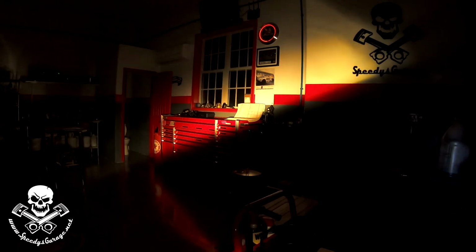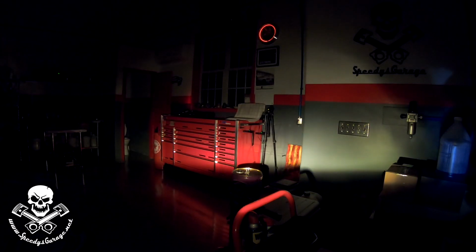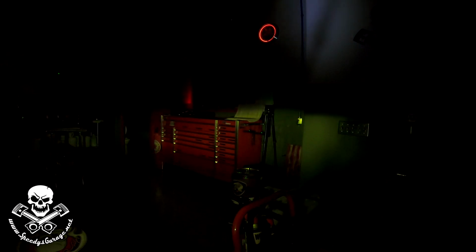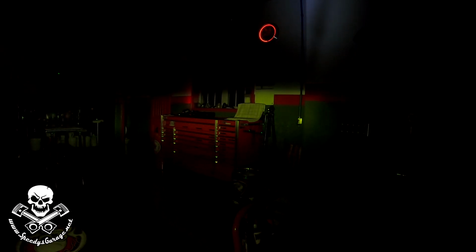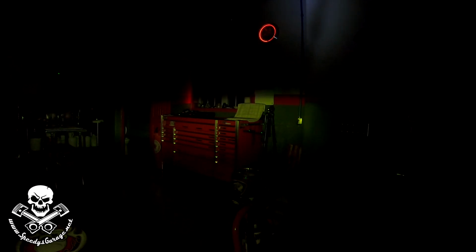I thought somebody might be super curious, so I turned all the lights off in the shop, and we'll do that same test. So here is the original H3 halogen bulb. There's kind of what it's going to look like. Here is the new LED. I would say it's about 80% as bright as the halogen, but it's drawing a whole lot less power. It's a nicer yellow color. These are 3000 Kelvin in color. So if you're wanting yellow lights, these are the ones to get, 3000 Kelvin. And again, it's just so people can see me. It's not necessarily to light up the road. I think this will work great.